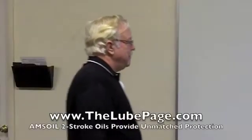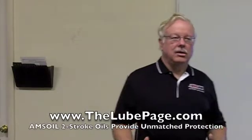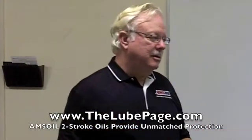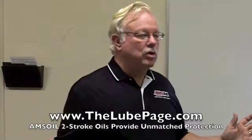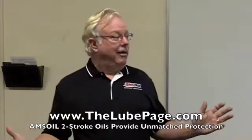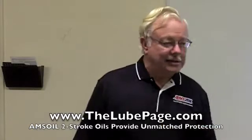And so making two-stroke oil is really much more challenging than making four-stroke oil. Well, think of it right off the bat. What's one of the worst things that can happen to your four-stroke oil in your four-stroke engine? It's gas in it. Yeah. Oh my God, I got 2 quarts of gasoline in my oil. I'm going to have to condemn it and throw it out.